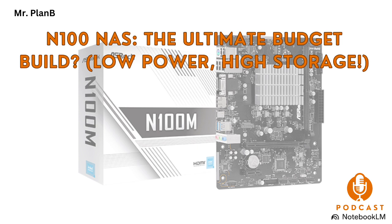But there's always a trade-off. What are some of the drawbacks we need to be aware of with these N100 boards? The main thing to watch out for is the limited number of PCIe lanes. These lanes are basically like the highways for data transfer within your computer — the data superhighway. An N100 motherboard might have fewer lanes than a higher-end board, and that could create a bottleneck if you're using multiple devices that need a lot of bandwidth at the same time. So if you're streaming a 4K movie, backing up your computer, and downloading a large file simultaneously, it could overtax the system — it really depends on the specific devices and how much data they're trying to move.